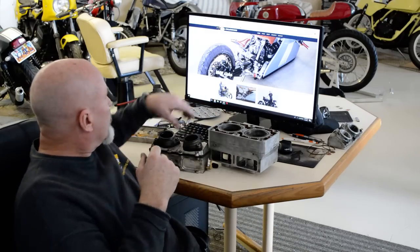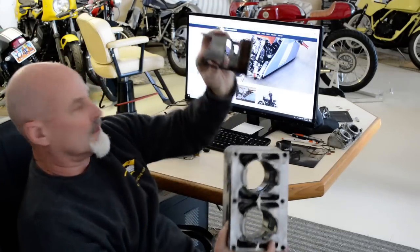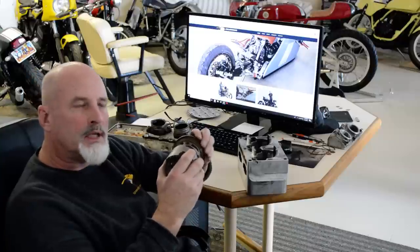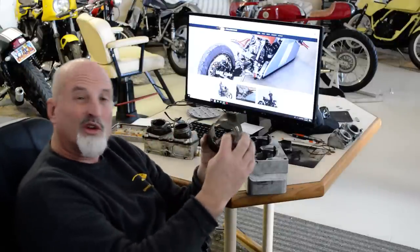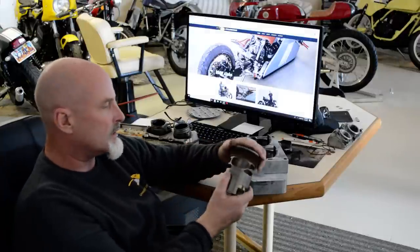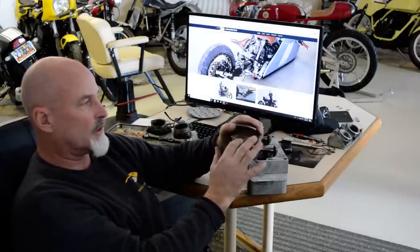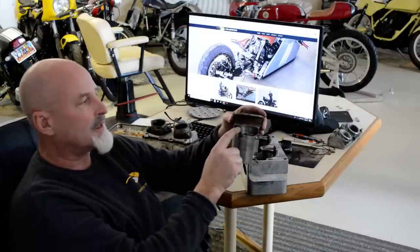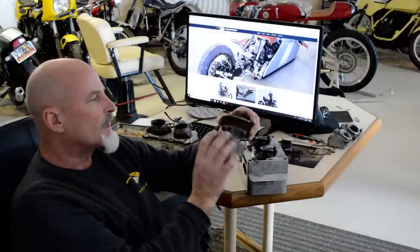Back to the engine — here it is. One of the cool features I did with this was the super thin liner. It's a cast iron liner; Durabar is the company that makes this cast iron. It works awesome. I wasn't sure, because it's only one millimeter thick, if it would withstand the abuse and just come apart — but it didn't. It worked great. You can see the heat coming from the exhaust because there's no aluminum backing between the auxiliary and the main exhaust. With the captured ring we're doing with the new piston, I think I'm just going to get rid of that. It may work, it may not.